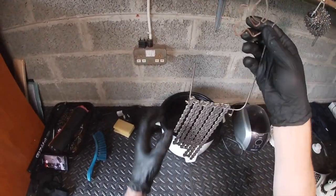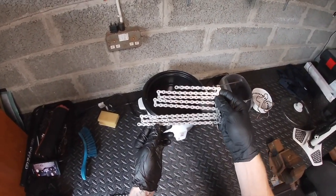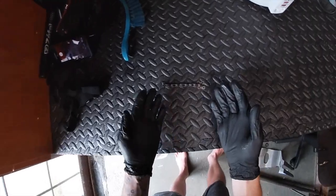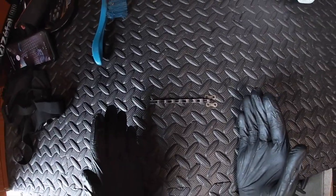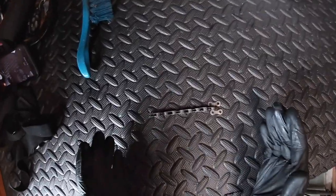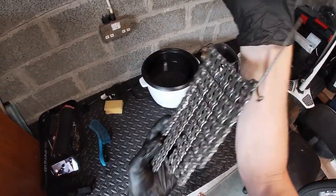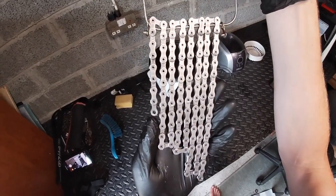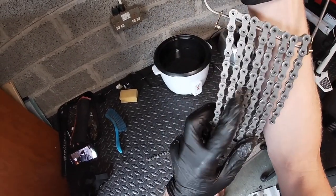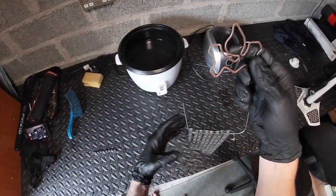We're back. That's been cooling — it's not completely cool but I actually took off the other two links as well. So we took nine links out in total — I think that's nine. We'll put it back on. Now you must remember that the writing side faces you. There is a writing side and a non-writing side, and the writing side has to face you when you put the chain on.